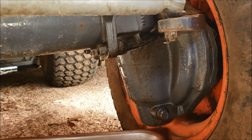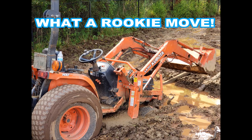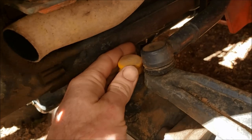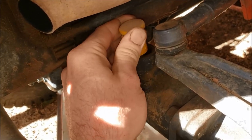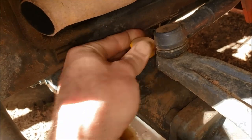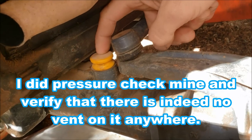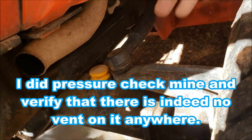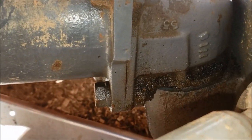It never leaked this bad until a guy borrowing it from me got it stuck. One guy mentioned, why aren't these front axles vented? And I totally agree with him. I've never heard pressure when I take mine off, but I am going to look into maybe tapping into this and running a vent up, because I do believe the front axle should be vented. When that gets hot, the air in there gets hot — it's going to build up pressure and could blow out the seals. But that's not the problem on this one.